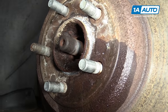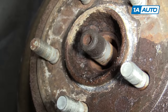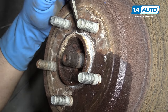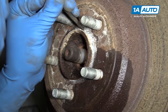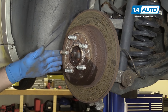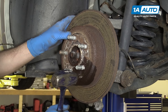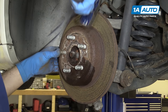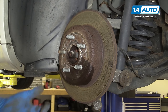Now around the ring of our rotor we have some very heavy buildup. This is from dissimilar metals — like the aluminum wheel being attached to these steel rotors and hubs for so long. To try to make it a little easier to remove, we're going to use a small chisel and hammer, just to break as much of that stuff out of the crease as we can so we aren't fighting it when we remove our rotor. Now this rotor is no good, so I could just hit the face of the rotor. But to show you another way — if you were to be reusing this — you can tap in between the studs on the face of the rotor to free it up from the hub. You may have to hold the rotor and tap this side to help release it. Ours is stuck on the e-brake, so we're going to have to remove it the hard way.